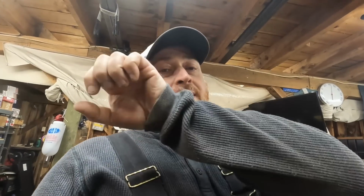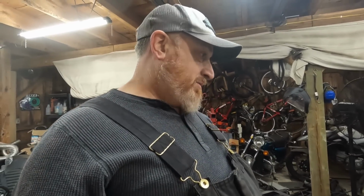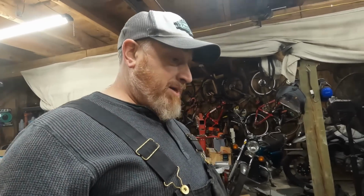I climbed underneath this thing, jacked it up a little higher, and affixed the fuel line, the brake line, and the harness all along the frame rail so it's nice and sturdy, so it doesn't bounce around and it doesn't chafe. I have another list. Every time I bring a list in, Jess is like, the list looks longer than it did when you started. It always is. So, unfortunately, that's kind of where we're at.